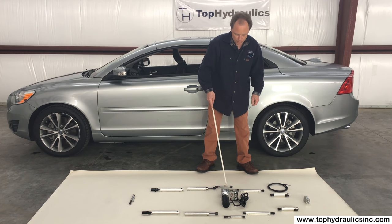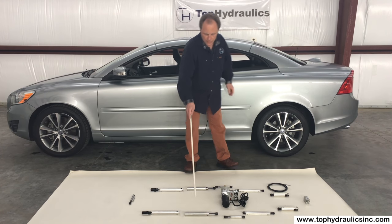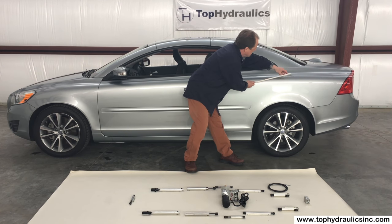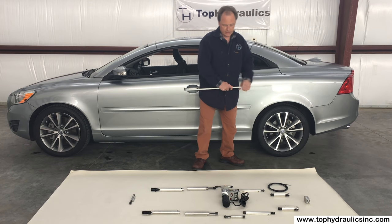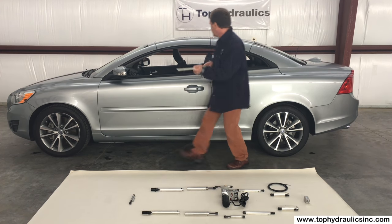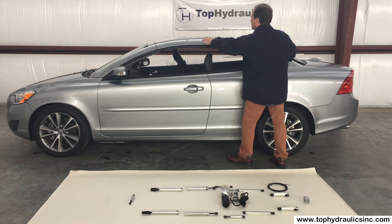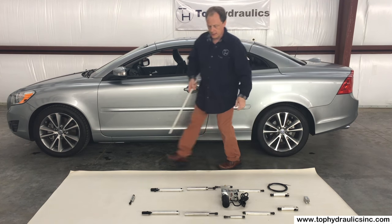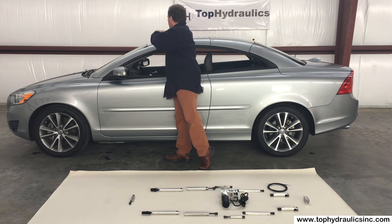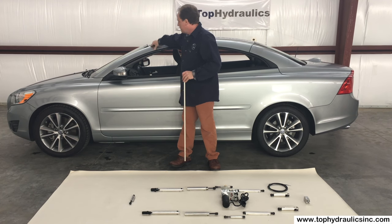Here are the frame lock or rear frame lock cylinders that latch the rear portion of the convertible top down. Here we have the master cylinders or main lift cylinders, mounted roughly here, that lift and retract the main portion of the convertible hardtop. The roof cylinders, mounted roughly around here, mostly move the front and mid portions of the roof and latch them to each other. Lastly, the front lock cylinder is mounted in the top panel in the center and moves the locking mechanism to lock the front of the hardtop to the windshield header.